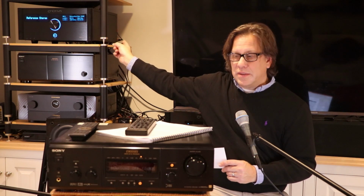We're going to use the Apple TV and the streaming services for the music, and play a variety of different types. And we're going to feed that. The way this is set up is the Apple TV is plugged directly into the Marantz HDMI port. It then goes on the output HDMI up to the Emotiva. And then since the Sony is only analog, the analog output of the Emotiva is sent to the Sony, and we plugged it into the mini disc DAT port, just one of the analog inputs. And that way they get the same signal at the same time to all units.